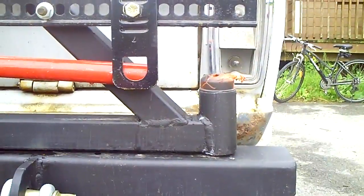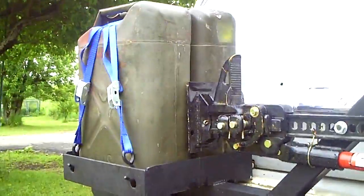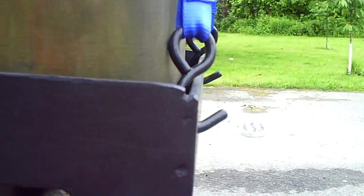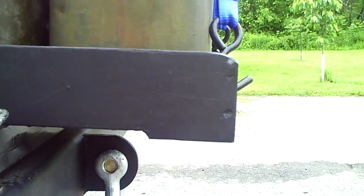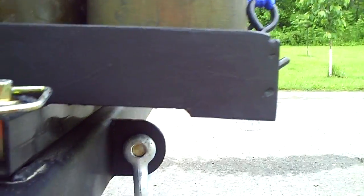The barrel hinge just barely reaches the backup light, so that's something you want to consider from a safety perspective. Using 70 inches of 4 by 4 and 12 foot of 2 by 2, I added a dual jerry can holder. This was made from scrap angle iron I had laying around — I basically just welded together a box. I got to admit I sort of rushed through this end of the project. I could have spent another week smoothing things out and double notching everything so they meet at a 45, but I really didn't see the point at that stage.